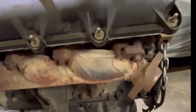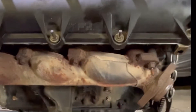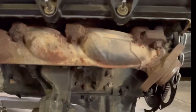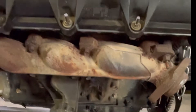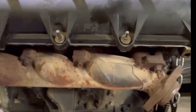The intake is still good if we need it. Right now all I think I'm remaining to do is put the exhaust shield on both sides, and I'm going to remove this engine mount. The way I see it, it's going to be a bigger problem trying to install it with the mount on — it was a little bit easier coming out, but going in it's going to be a fight. So I'm going to remove this engine mount, stab it to the transmission, then reinstall the engine mount.